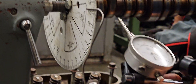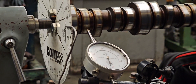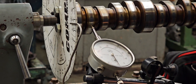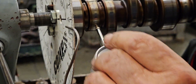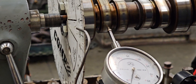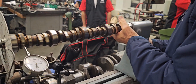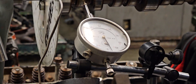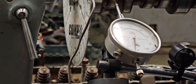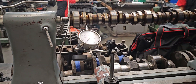Let's see what we've got now. It's still not very round — that's pretty good, let's see. I'm looking for this to be centered here; the bottom part should be fairly close to zero. But this thing is moving around — that's a few thou out. When it's right, it doesn't move at all. This moves up and down too.